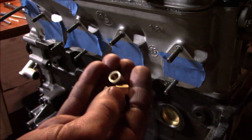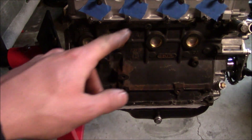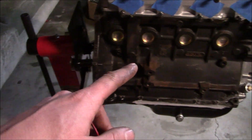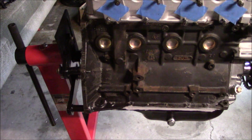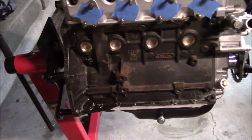I'm a big fan of these low-profile intake manifold nuts. Now I'm going to go ahead and get the seams with the head and the chain covers taped off and then paint the block. I know I'm a little bit of a weirdo because a lot of people paint the block first, but I actually like to do it at the end — so that's what I'm going to do.